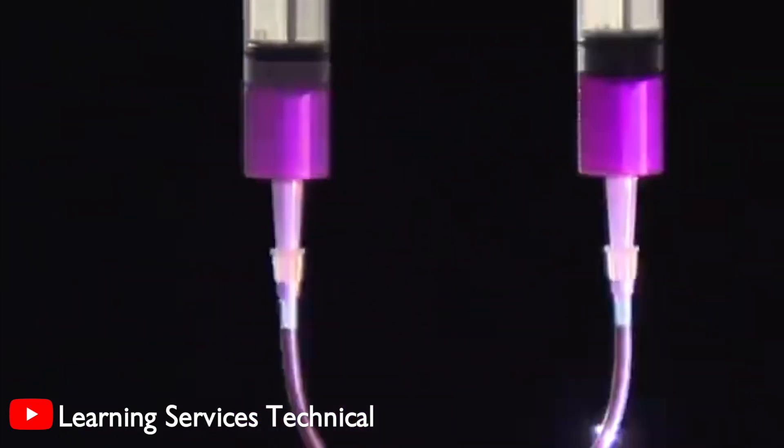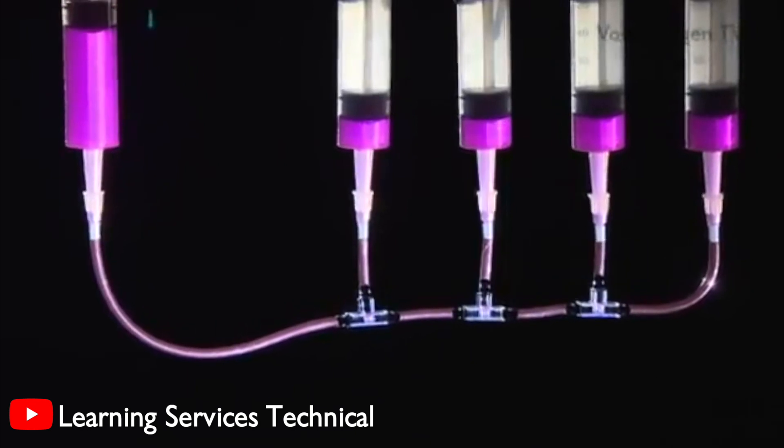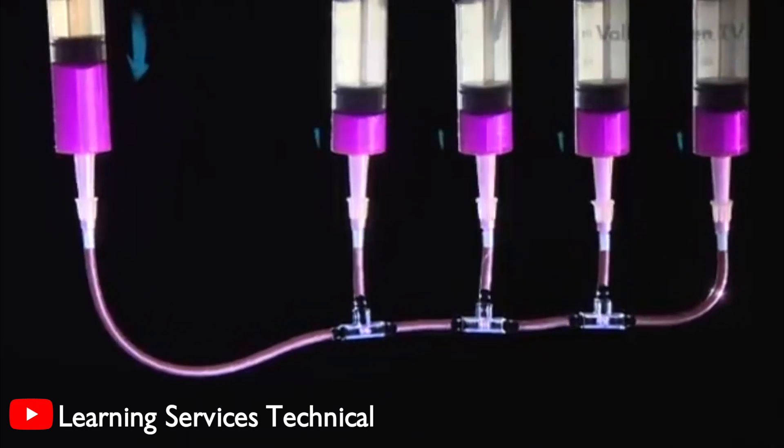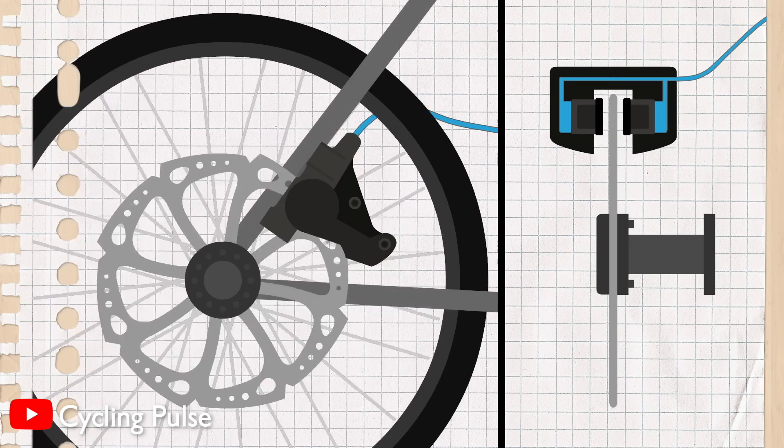The other variant is the hydraulic brake. As the name suggests, it's hydraulic. There's fluid in a brake line within a vacuum. In the brake handle, instead of having a cable and a lever, it's going to push a piston that moves oil from the tank of the brake handle. You press on it, the piston pushes it through the brake line — it's all sealed — to the caliper, and then there's an exponential pressure applied on both brake pads to squeeze on the disc.